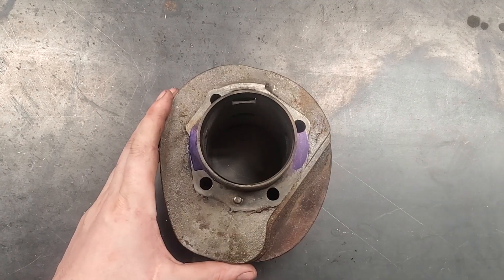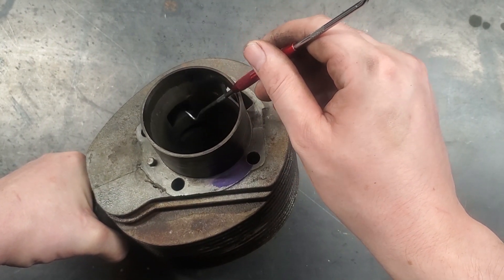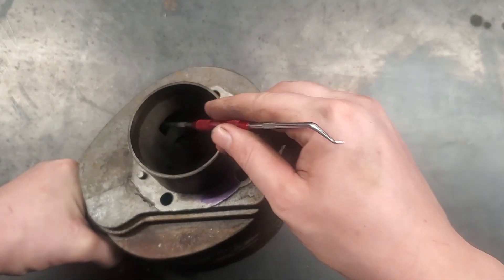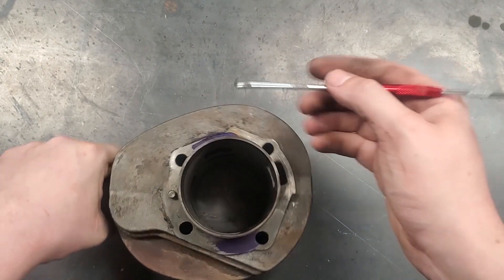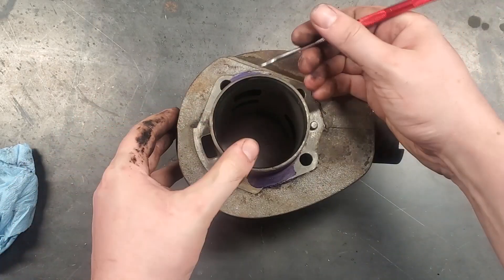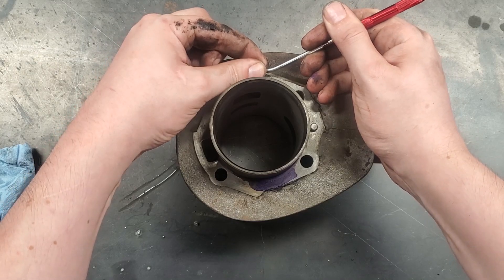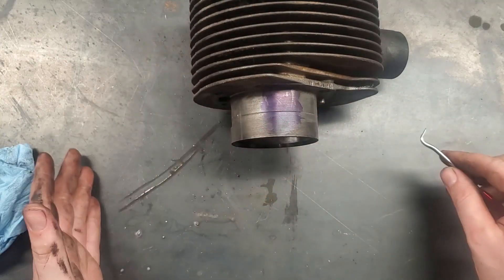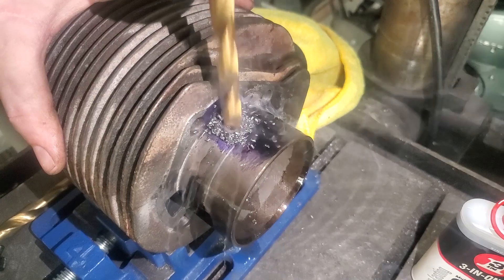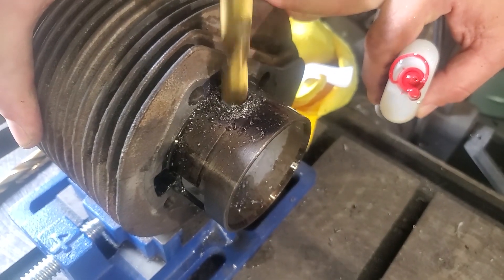While the cases were taking a bath in the ultrasonic cleaner I started working on the original cylinder. The goal here is to use the existing port which usually is just fed through the piston, and above it cut an extra port into the cylinder on each side, so we can have basically case ports on a stock P200 cylinder. The initial attempt to mark the ports doesn't have to be super accurate, you can just eyeball it. The main goal is to find a nice center line to drill holes into that give a start for the Dremel. I was able to drill a hole to a width of half an inch which takes a lot of strain from the grinder later on and makes it easier to get started on these ports.